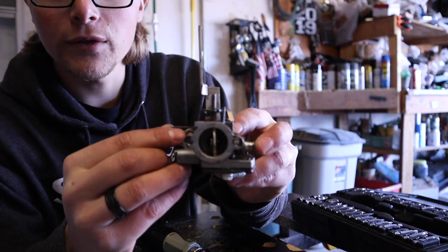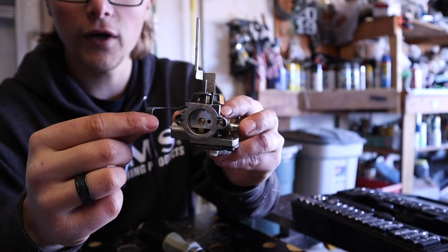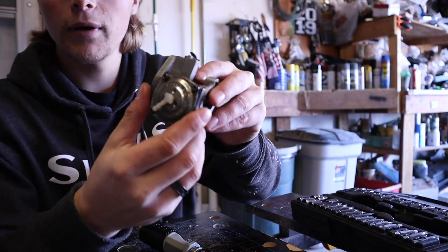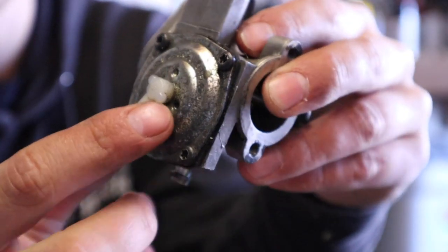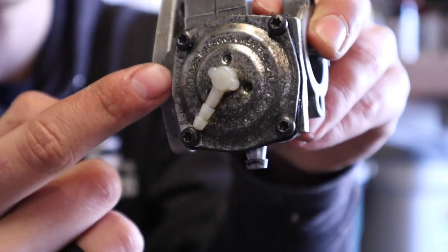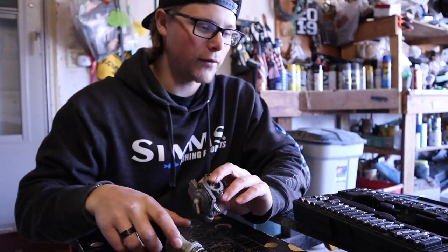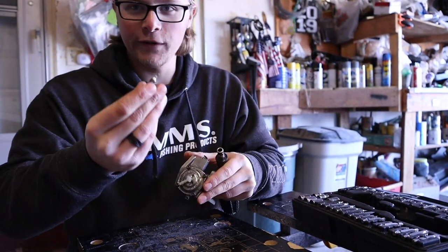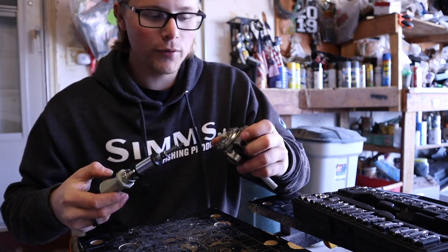Now you can see better. Here's your choke — when it's closed it's forcing more fuel in and cutting off the air, and when it's open it's letting air in normally. The next step: on the bottom here we have our fuel bowl. Even though there's no actual bowl, it's just a little spring. We are going to take this off because there's a diaphragm in it and we're going to be soaking it and we don't want that diaphragm to get ruined. So I'm going to find a star bit that fits — perfect. Next step, we're going to take off all four of these screws.